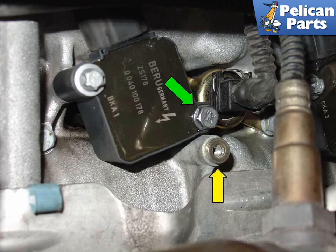In this photo it shows two 6mm flat stacked washers (yellow arrow), but I later found a fat 6mm washer which was the same as the two stacked — either way works. I used a little bit of grease to let the washer stick to the valve cover to aid in assembly.